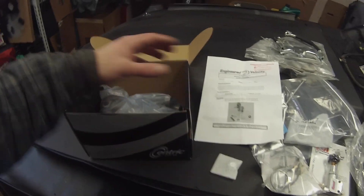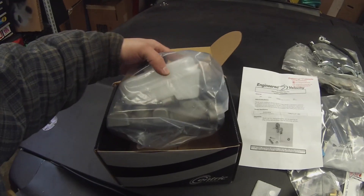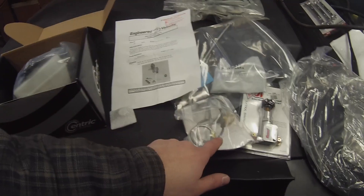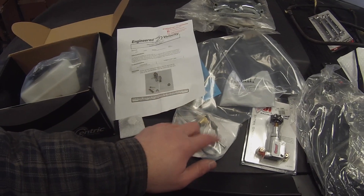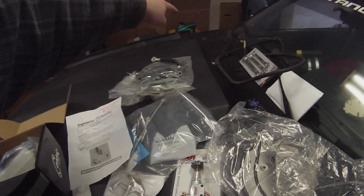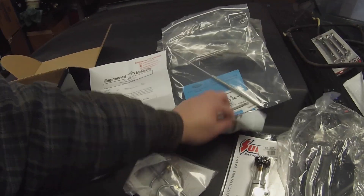I've acquired pretty much the rest of the parts I need for the disc brake swap. We have the '93 Cobra master cylinder, the one bolt that goes in the stock proportioning valve, and the Maximum Motorsports brake hoses or lines that go from the master cylinder to the stock proportioning valve. Then I picked up the proportioning valve that needs to go on the passenger firewall side for the rear, and the Ford Performance parking brake cable adjuster.